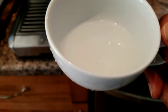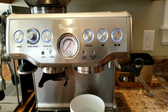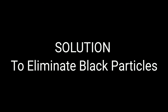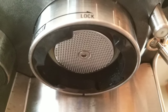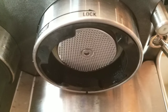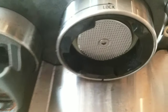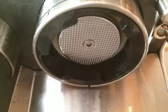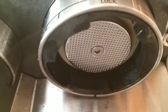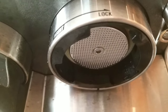So how do I permanently eliminate these black particles coming out continuously, even after cleaning and even after back flushing? We'll have to open the group head. The black particles are floating somewhere between the group head screen and the group head — that's where they are getting trapped. I'm going to open this and show you. This should also be part of your monthly cleaning process.